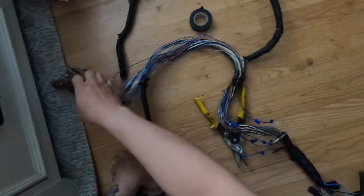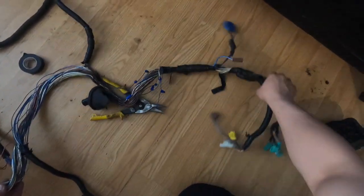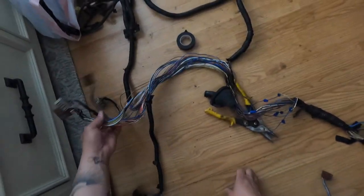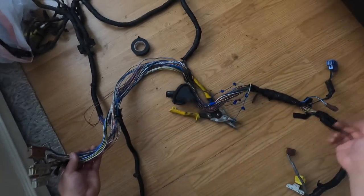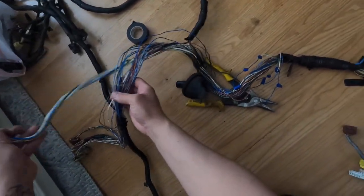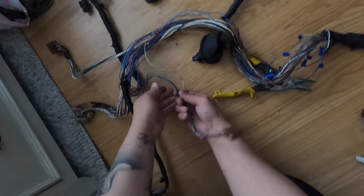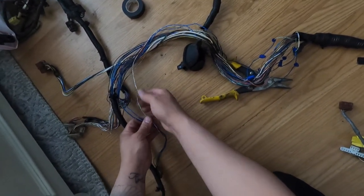The first thing I want to do is get this fuse box inside the car. I took this off — basically I just cut it like that. This is the firewall; inside the car, before this goes inside the car, we just want to pull these back inside. Some of these wires are not going to want to pull back — those are the ones we'll have to label, number them, then cut them and pull back whatever we can and then extend those. This one and these three blue ones are heading out that way, so I'm going to have to cut and label these.